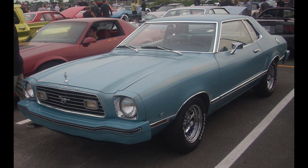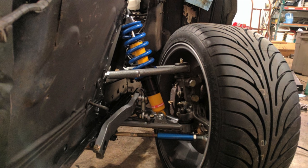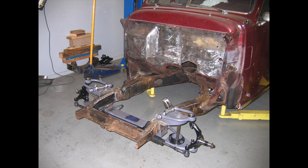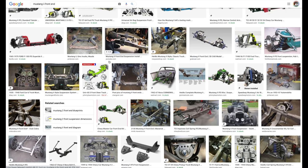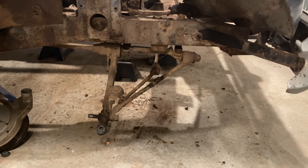I'm going to use a Mustang II front end — not exactly a Mustang II front end, but some aftermarket stuff that meets the Mustang II kinematics. This is super common on hot rods. Back in the '80s or so, somebody figured out they could rip out the front suspension from a Mustang II and stick it on their 1940-whatever Ford, and it caught on so much that now there are dozens of companies selling hundreds of different Mustang II kits for all sorts of cars. There's a huge aftermarket ranging from rusty junkyard parts to shiny expensive chrome pieces. I'll be going somewhere in the middle and changing up the suspension points a bit to mate with what's already on the Jag. It's not perfect, but it's pretty good — and buying off-the-shelf stuff means I don't have to fabricate or design everything from scratch. This thing's never going to handle like a brand new BMW, so it's probably good enough.